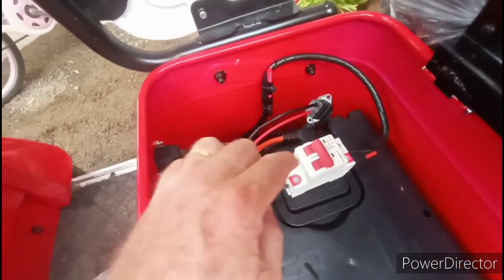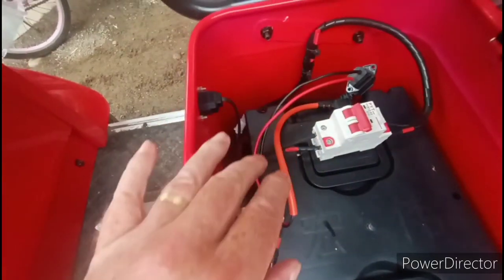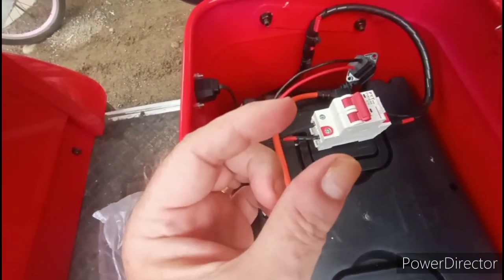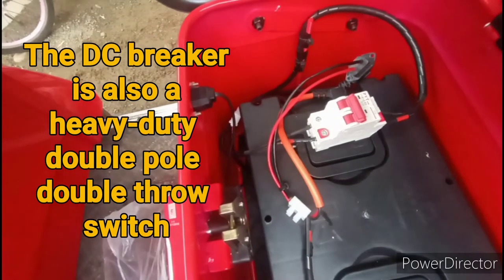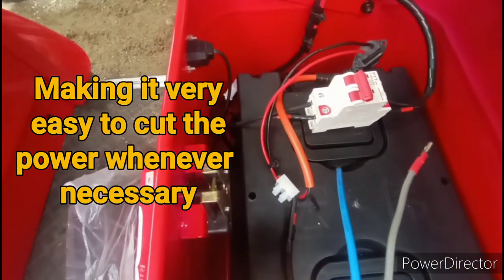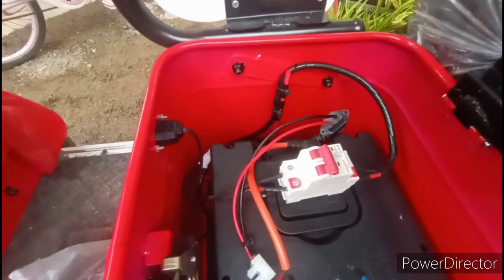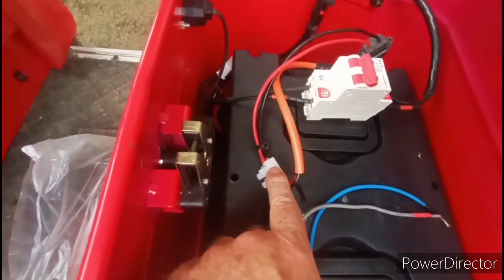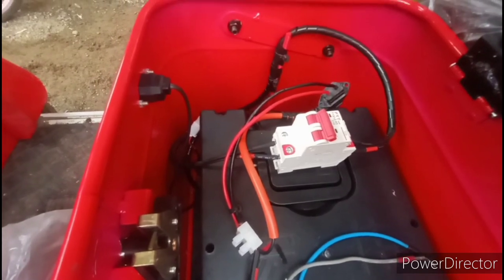You could take this right here, and in place of this, you could put this type of breaker — but it would have to be a 20-amp breaker. It would have to match the circuit fuse link that's inside the battery box. You don't want to go less, but you could get one of these, add a couple of jumpers, put it in line, and then leave the 20-amp in line for going to the e-trike. If you're going to use one of these, get a 20-amp one, put it in place of this Euro connector, and that way you'll have plenty of protection all the way around. A 20-amp breaker will be just fine — it's going to disconnect fast, just like a 10-amp breaker would.